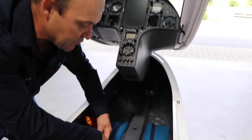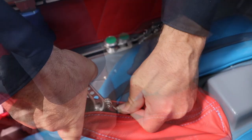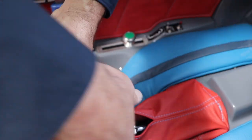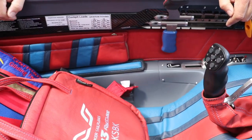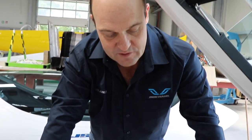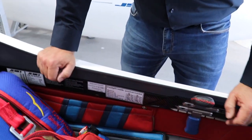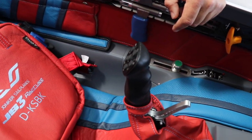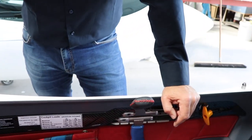The JS3 is also equipped with a park brake. You pull the brake back and lock the pin into the locking position — the park brake is on. It's quite firmly adjusted, and if you just pull the brake again, it releases. This allows you, if you've outlanded on a slope and want to prevent rolling backwards, or if you're on a sloped runway, to leave the park brake on. It's quite a neat feature that's normally not available.